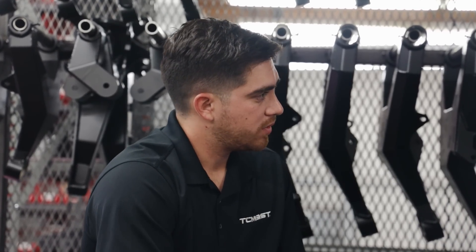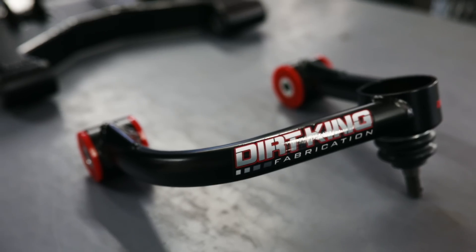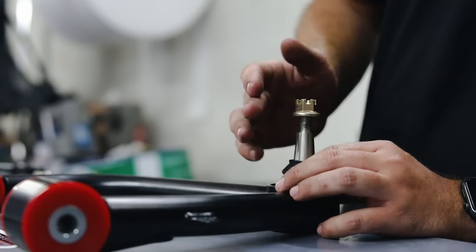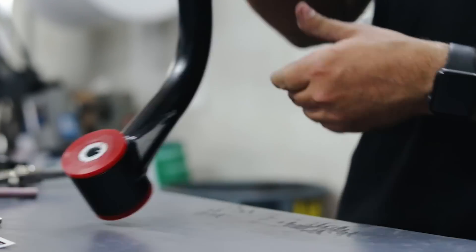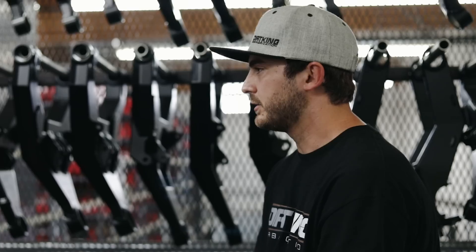That process — just the whole fabricating part — is just crazy. Now let's go ahead and talk about these upper control arms that are going to be installed in the truck. So you guys will be installing our control arms, our tubular design. They feature a polyurethane bushing at the inner pivot and a ball joint at the outer pivot. The nice thing about having a ball joint on this type of application is it's less maintenance, and it's really good for an all-around use — daily driving and off-road use.